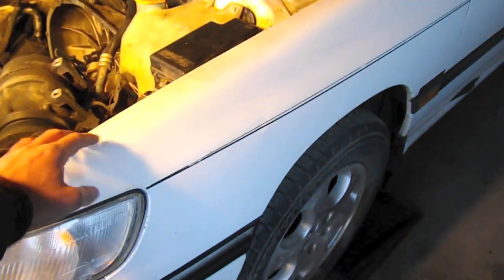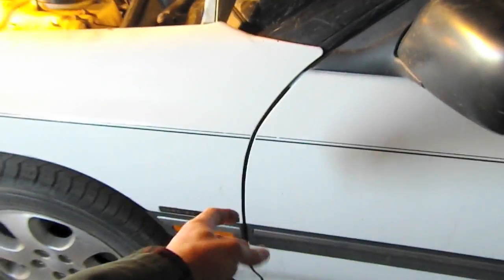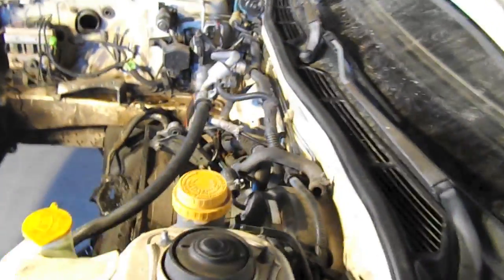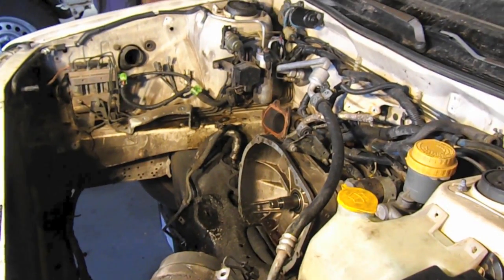We've got the engine connectors sitting right down here. We're going to pull off the driver's side fender and remove the wiring harness that goes to the back. There's a big grommet that sits right about here and goes into the dash itself. So the next move is clearing the items from the engine bay that we want to keep and pulling the dash to reveal the wiring harness. Also need to make sure the pins that locate the engine to the transmission go with the engine.